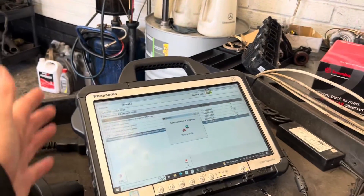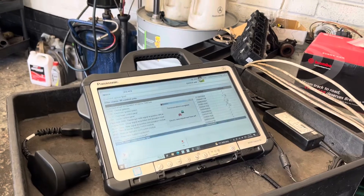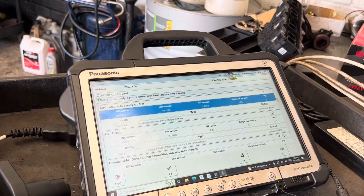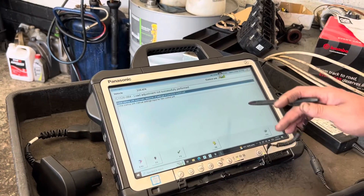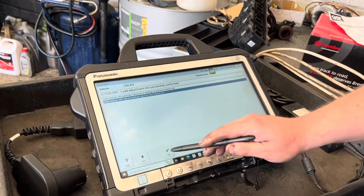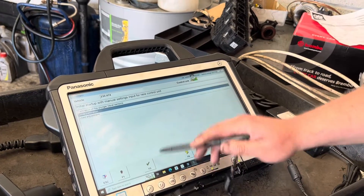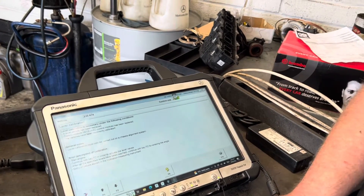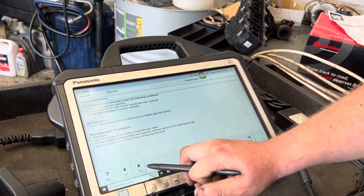They're using a top-of-the-range, state-of-the-art wireless Star system here — no wires to the car. They're just doing a full scan to see what the car throws up — obviously it's throwing an ABC visit workshop code. When you fit a new module you just copy the old stuff off the old module and transfer it. I asked about the order of calibrations, and confirmed you've only got a code for level calibration so that needs to go first.